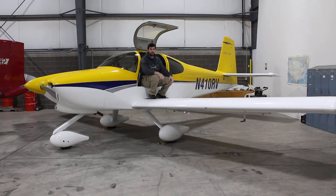You can fit three people in a 172, but your range would drop to maybe 250–300 nautical miles — about three hours worth of fuel plus reserves. An aircraft like this, you can fit four real people — four 200-plus pound people — so a total load of about 800 to 900 pounds, and still carry about 65% fuel, which would give you about three hours of fuel plus reserves. And this thing's doing 165 knots — a 172 isn't. So you're still going to get nearly 500 nautical miles with four real adults. You're looking at six-seat aircraft for that.